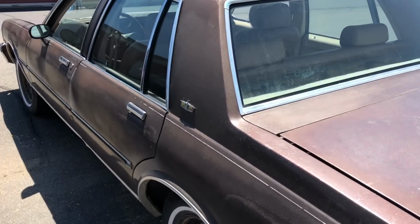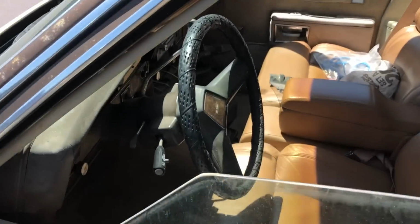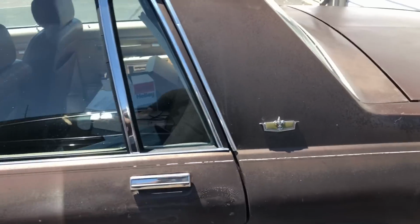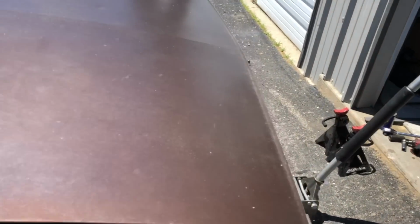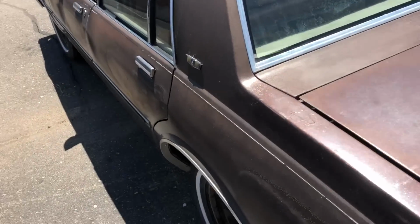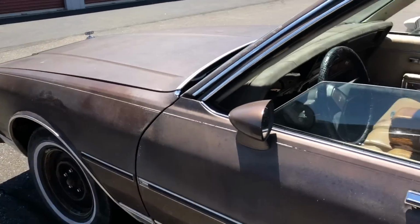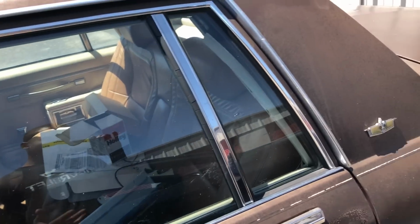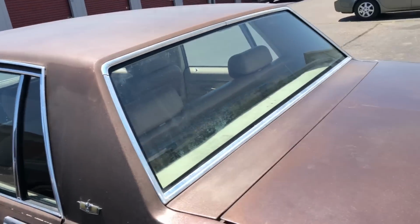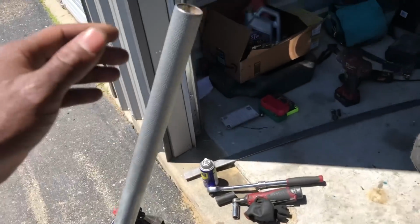I had some dreams for this car, man, but eventually it's gonna end up leaving because I can't take it, but I don't want to take it. So what I plan on doing is respraying. But if we actually out of time, it literally takes like 4 or 5 hours to bare metal all this surface rust, and then I can respray it that brown that came with the Malibu, that light tannish brown. It's over there. And get some clear. So that'd be like a $400 job, a base clear job.